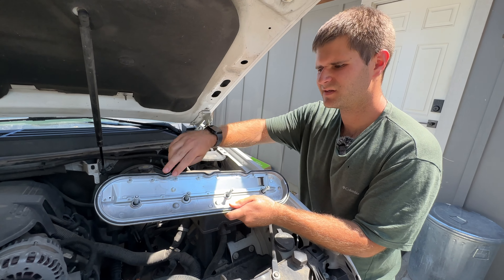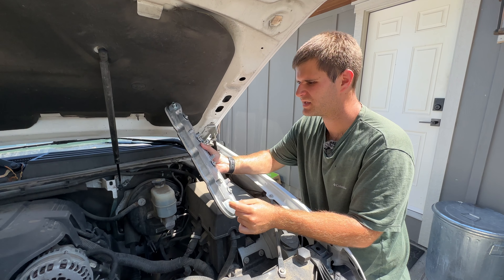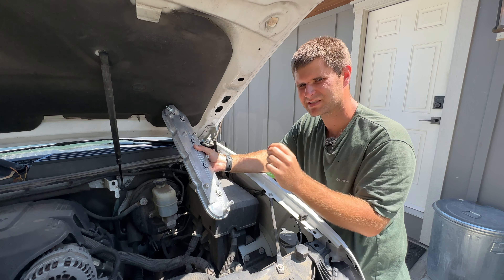It's got the PCV valve. This is a replacement one — here's the part number. This is from Dorman. On the factory valve covers, there are holes all along this rail. So when you're going down the highway, the rockers splash oil up into there, and if you're going down a hill with your throttle closed, it puts a bunch of vacuum and ends up sucking all the oil into the intake.